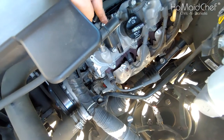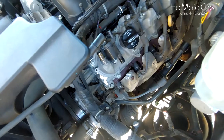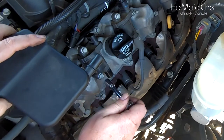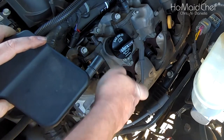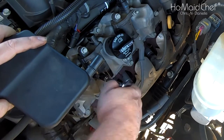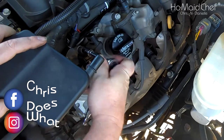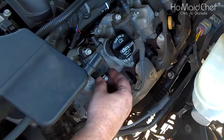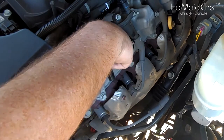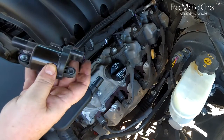For your plug, you just pull that off right there. And you have two bolts that hold your coil pack in place. When you're ready to unbolt your coil pack, it's a 10mm. If you're like me, most of these are broken, so we'll use this really small one. Hopefully I don't break another 10mm. These are pretty easy to get out. And that's it - it's off.